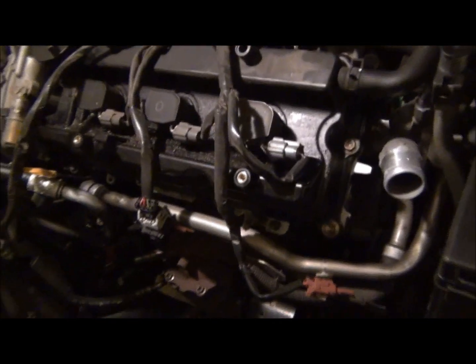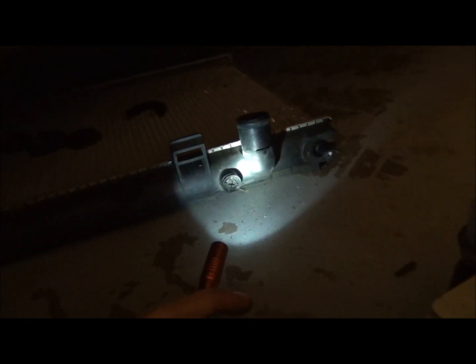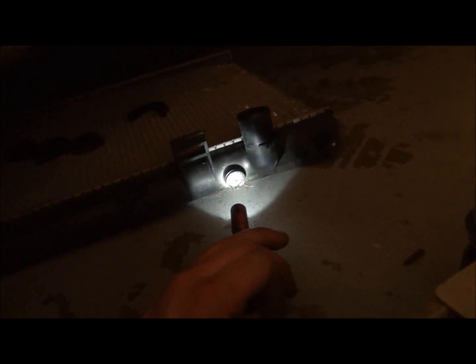So anyway, I have caught the coolant. You know, the radiator right here, the fan and everything. So on the bottom of the radiator, let's see, bottom, top. Who knows? Top, bottom, right over there. That's not a good video, is it? Okay. Right there's a lower radiator hose. There, you can put a Phillips in there, like a P2, I think fits. P3 probably fits pretty well. Anyway, and you can pull that out and drain the radiator.